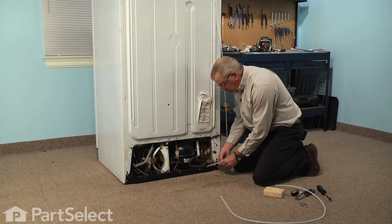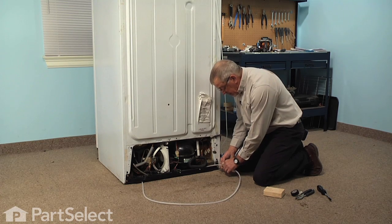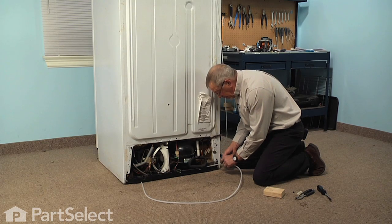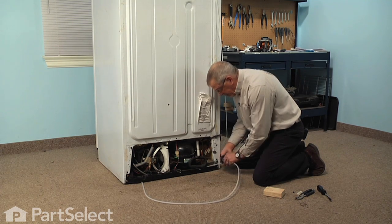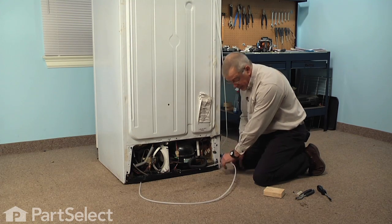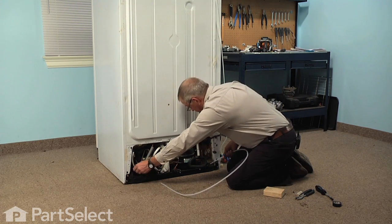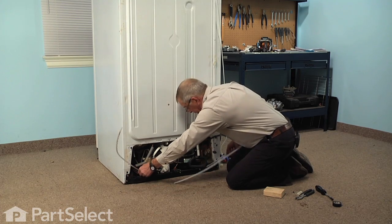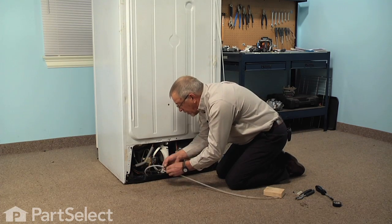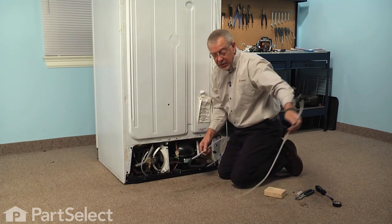We'll slide one end into one end of the tubing. We'll take the new tubing, slide it onto the other end, and then we'll tape the two pieces together with a little bit of electrical tape. The metal screw just provides a little support at that joint so that it doesn't flex. Now we can feed that tubing through. We'll pull on one side and push on the other until we've pulled it through, and we'll unravel our tape. And we can discard the old tubing.